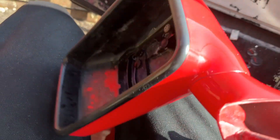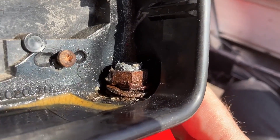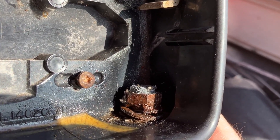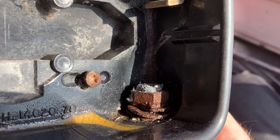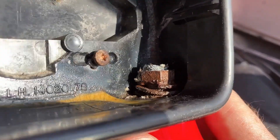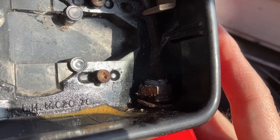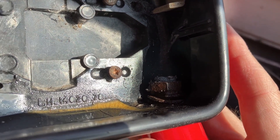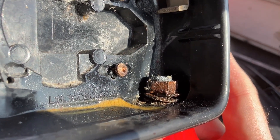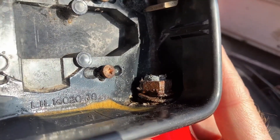It's just a piece of shaped metal in there with no access to any screws or threads. Anything that can address the wobble is just this nut in the corner with a sprung washer. As you can probably see, it's all corroded, so it's not really going anywhere and probably not applying quite enough pressure to hold the thing steady. In a certain position it does hold, but the moment you fold the mirror back in or out a little bit, it wobbles. I'm not sure whether I can jam a washer in underneath it to give it a bit more purchase on the mirror housing.